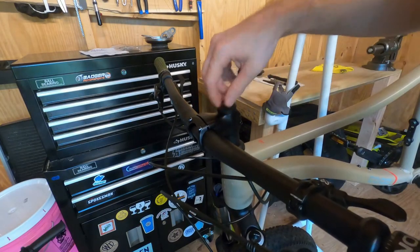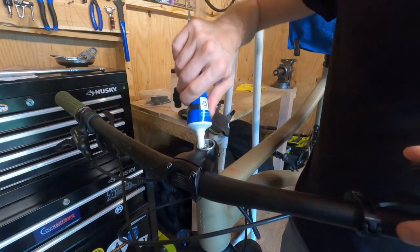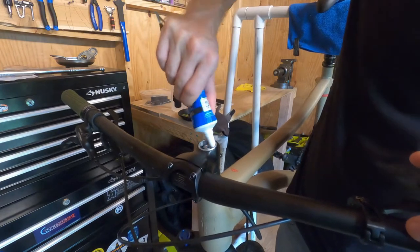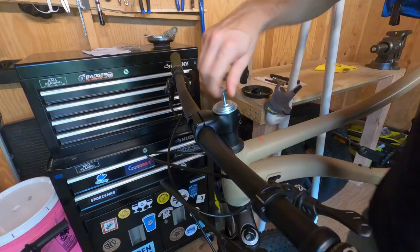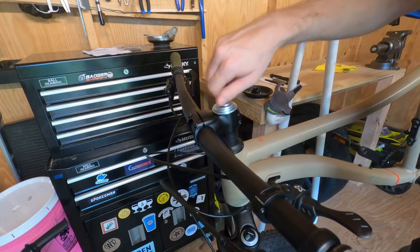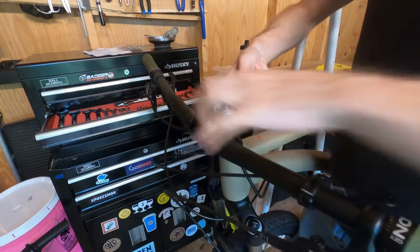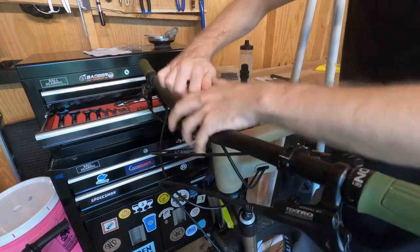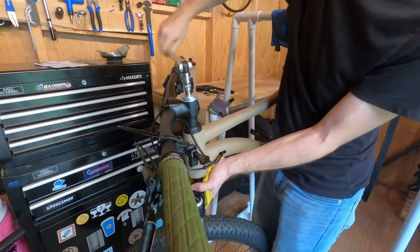First, remove the top cap and add a bit of grease to make the star nut easier to remove. If you buy the tap kit from 1UP Components it comes with a special tool for this, but with 75 cents worth of washers and a long M6 bolt we can pull it out ourselves. The idea is that if we put the bolt all the way in and continue to tighten it down, since the bolt can't go any further down due to the washers, the star nut will be pulled up out of the steerer tube instead. You can probably muscle it out with a normal wrench, but if you have a breaker bar this is going to be a lot easier.